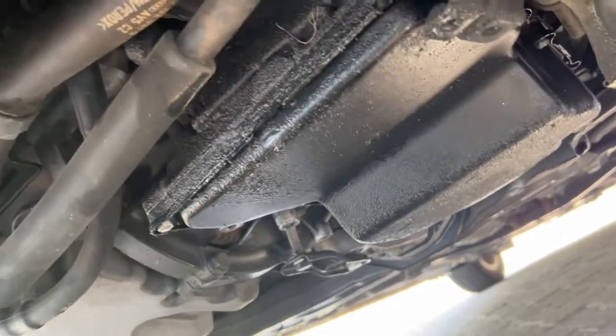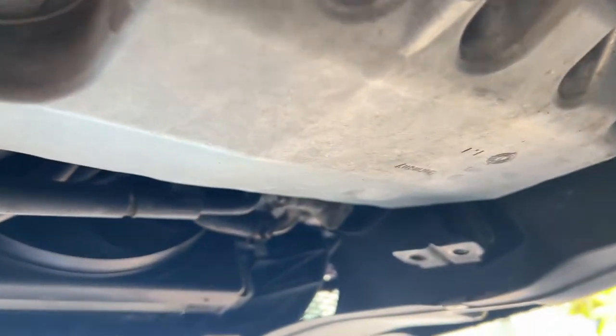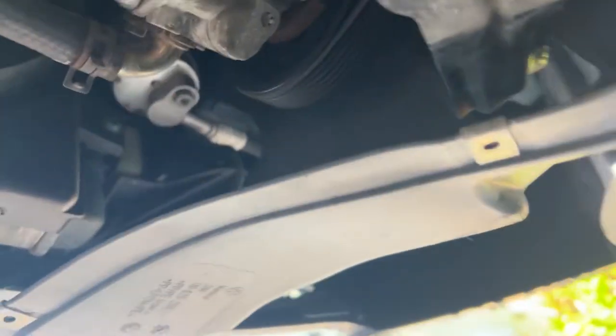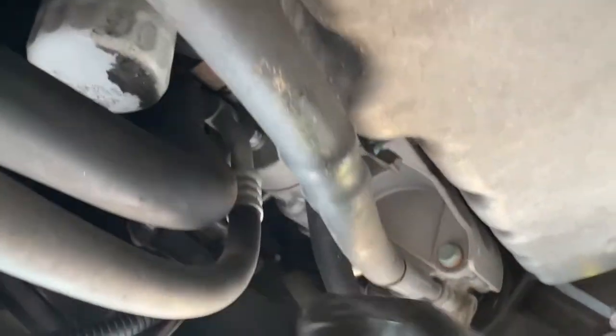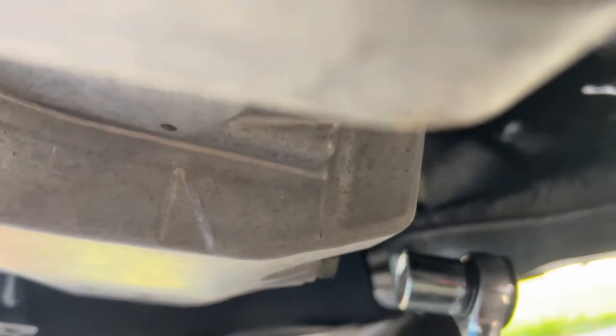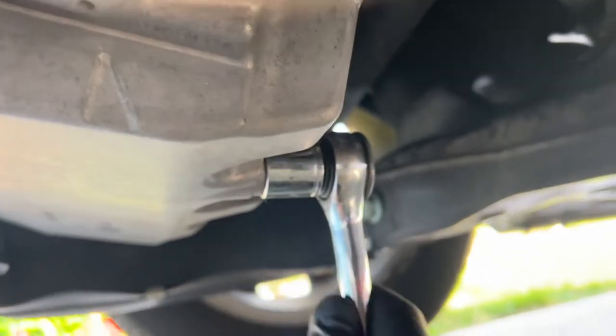This car's only got 15,000 miles on it. We have revealed the oil drain plug on the back here, which looks like it's pretty big — got to be a 19mm. And on the front of the engine, you can see right up here the oil filter. Hopefully — oh yeah, it's loose, it comes off easy. We got a 19mm socket, we're just going to check and see if that's it. That is it — okay, we loosened it.